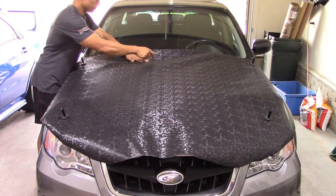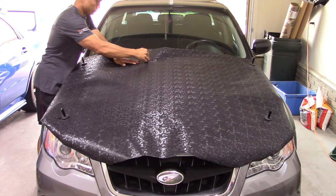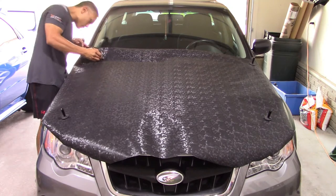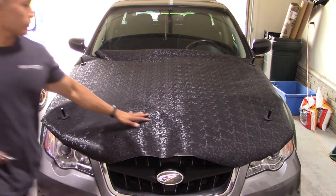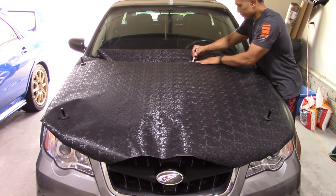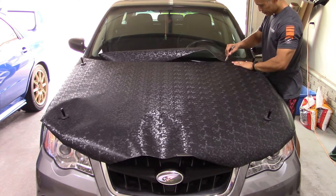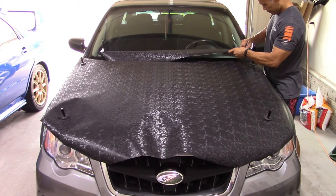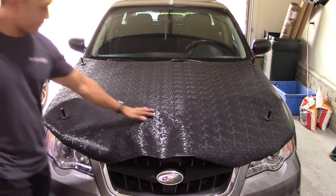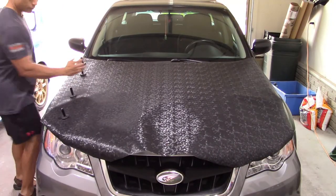On the back side, I'm trimming that out, finding the back of the hood and leaving about two inches there as well, because you can see how much vinyl goes up onto the windshield. If you've wrapped hoods near glass before, you probably know that the adhesive hits glass — because of its high surface energy — and grabs onto it really hard. With that much excess vinyl hitting glass, I'd be fighting it once I take off the backing paper. So now I've got the windshield side and grill side trimmed out.